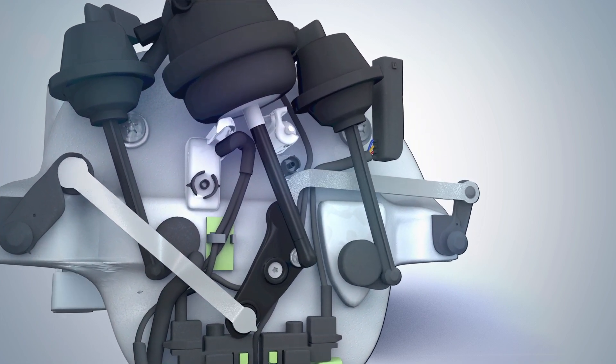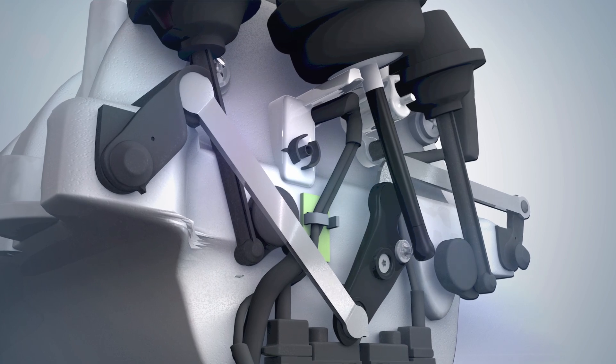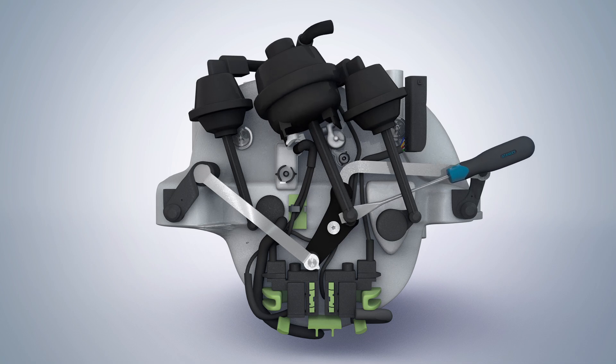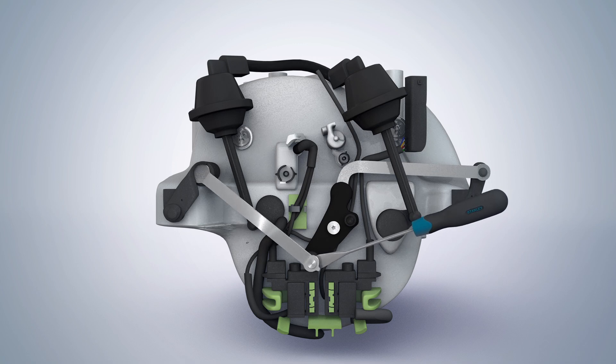Installation of the Europremium intake manifold kit typically requires removing the manifold from the car. Follow the standard shop procedures to remove the manifold. Remove the original central plastic vacuum actuator by carefully prying off the push nut, unsnapping the actuating rod with a flat-bladed tool from the central pivot lever, and carefully disconnecting the single vacuum line.